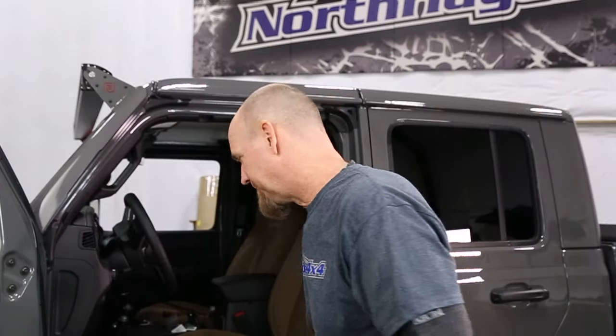We're going to do that with the Mini Tazer from Z-Automotive. This little box will allow you to change all kinds of things, including tire size. That's right, we need to set this Gladiator up so that the computer is reading it has 40-inch tall tires, not those little tiny things. It'll also allow you to adjust the PSI warning for the tire pressure monitoring system. And of course, with a big tire like this, we will be running a different PSI than the stock tires. It's small, it's little, and yes, it goes in really easy. So let's get to it.